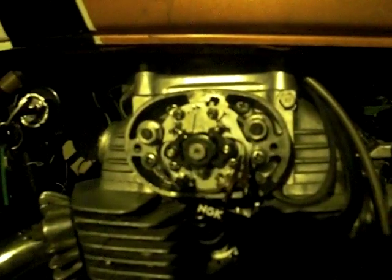we can probably do something with this adjustment. What we need to do is move this points base plate and rotate the whole thing. I can't remember if it's left or right, but that should counteract — we'll move it so that the left fires on time, and that should also at the same time make the right fire on time. Let's hope.